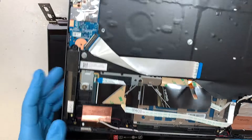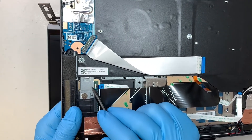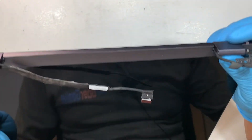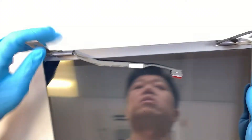The only component you can likely transfer is the touch ID — remove its screw and take it out. For those interested in a screen replacement: this screen is a 360-degree fold, meaning you can use the laptop as a tablet. Because it's a touch screen, don't just replace the glass — replace the whole full screen assembly with the hinge. That's the recommended approach for this 360-fold design.